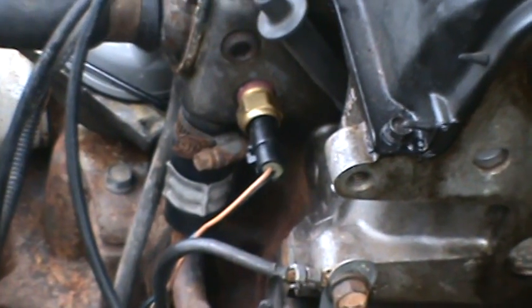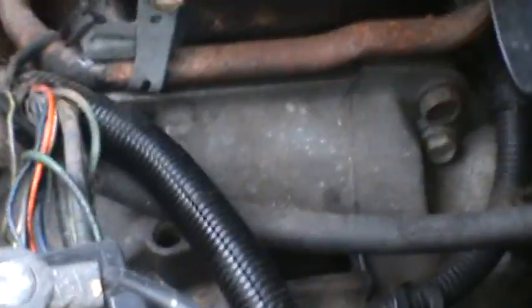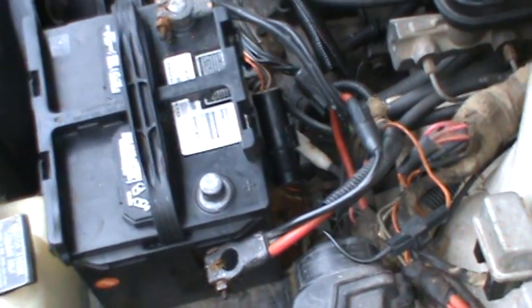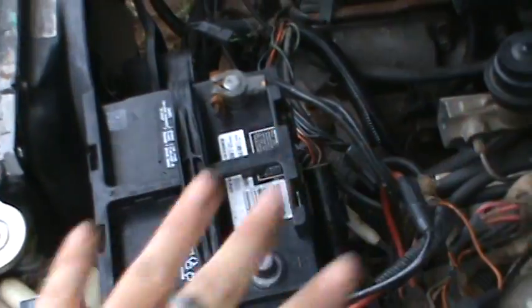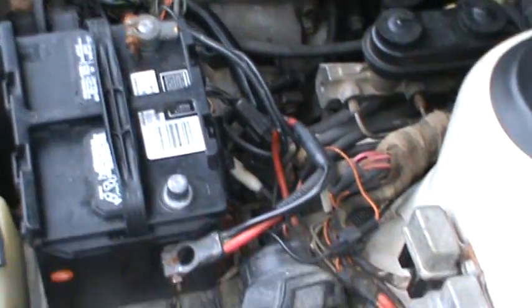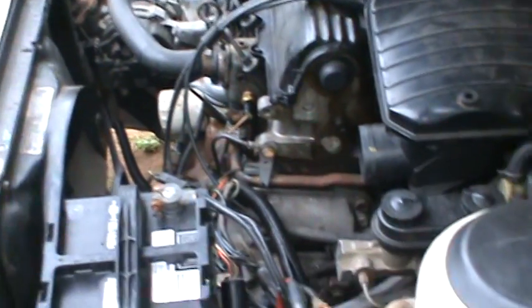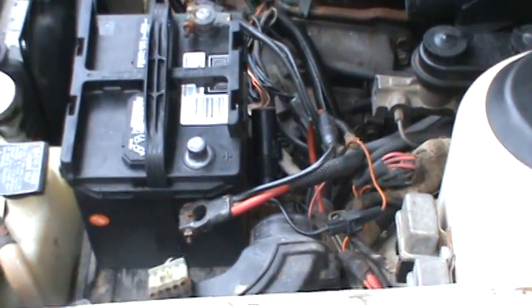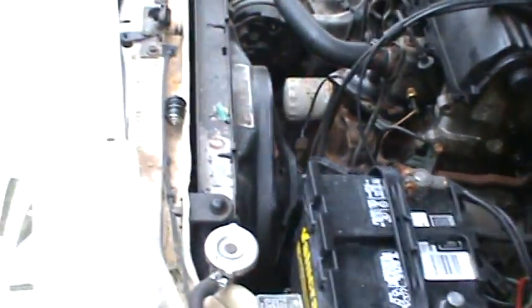either there's been another bad sensor, which I thought was unlikely, or maybe the wiring was just ratty and loose. And I think it's the wiring, because when I put all this back together and had this connector apart and back together several times, it stopped. The fan stopped coming on, and the power loss light stopped coming on also when I turned the key on. I didn't try to crank it because I've got some other things apart over here, but I may have managed to solve that issue, hopefully. If not, I'll have to just go ahead and get another sensor.